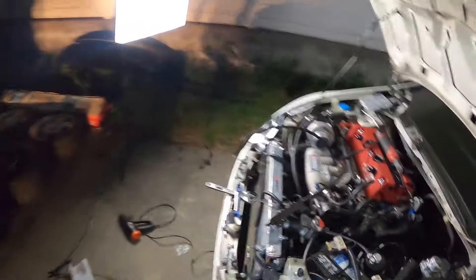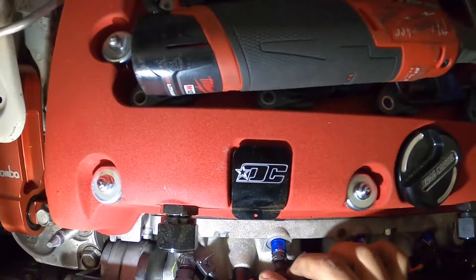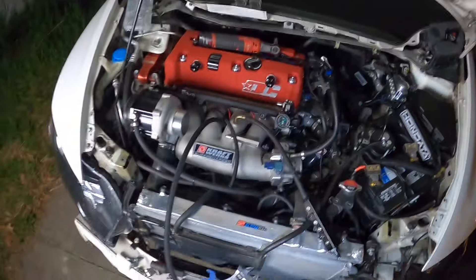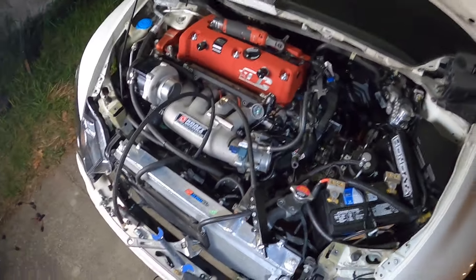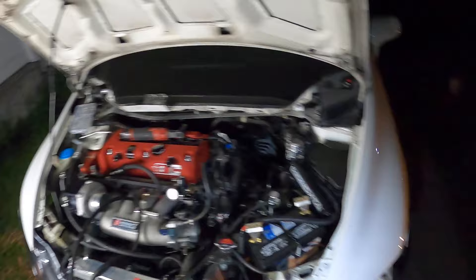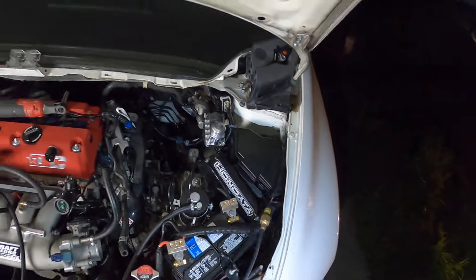It comes here to the center. Real quick, let me also show you guys — the injectors are fully wired and it looked pretty good. Put the ground over here for the harness, so it's looking pretty good so far. I just got to tighten up these lines, make sure they're not leaking, and then I'm gonna start working on all the vacuum stuff so we can get the blow-off valve working and a working boost gauge.